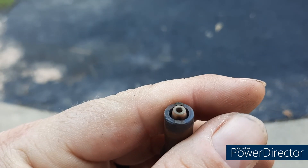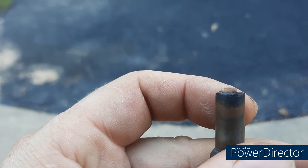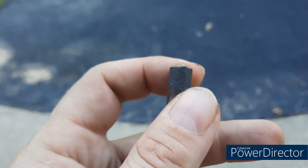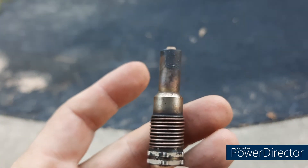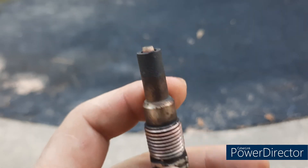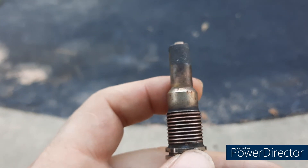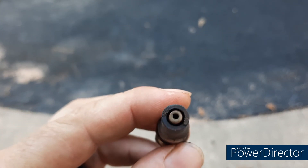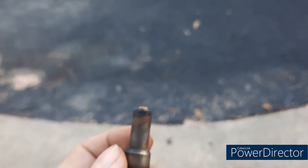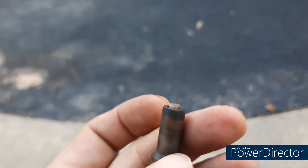I put that old spark plug back in — it was the cleanest of the ones I had from before — and it kind of woke it back up again. Up until the other day, there were no signs or indicators that this was bad, other than the ticking sound that it was making. I had a feeling it could have possibly been a loose spark plug, but it's a lot of stuff to take off and put back on, especially when you can't afford downtime with your vehicle. Next time I'm going to have to take that downtime, because it could have been a lot worse. If you've seen something like this before, comment and subscribe — let me know any ideas about what you think could have caused that, and if it's happened to you before.